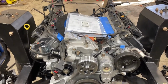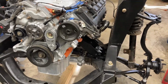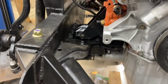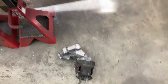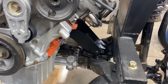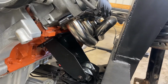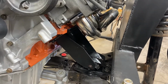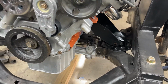and that went in and out and in and out and in and out, because the motor mounts, which are right in here and right in here, are custom made now, because the stock ones, which look like this, didn't fit with the headers, which seems like that's always the case. Headers never want to fit around anything, so I made my own, and those will work just fine. They're actually closer to what the SRT8 motor mounts are like.